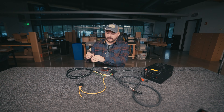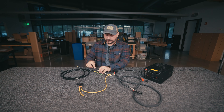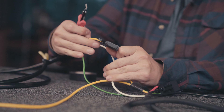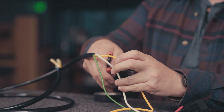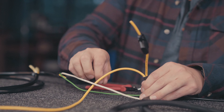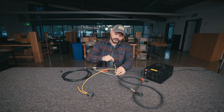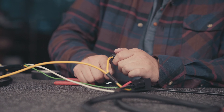To do this, locate the side of the harness that goes to the switch — the side that has a green, a yellow, and a white wire. You're going to locate that yellow wire and make two cuts. Grab your cutters and make the first cut right on one side of the little fuse. Then you'll see the rest of the yellow wire has a fuse and the terminal side that goes right to the battery — you want to keep all of that. The second cut goes right at the base of the heat shrink where it junctions two wires into one.